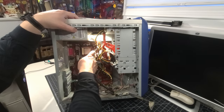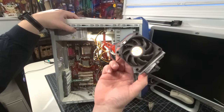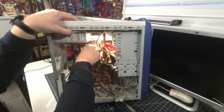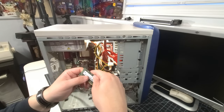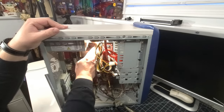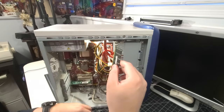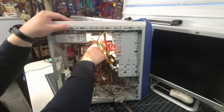There's dust just caked on the board — a direct result of that blanket of dirt inside the heatsink and fan. The memory: three slots on this motherboard, and my guess is DDR. I pull out 256 megabytes of DDR 266 memory. I bet the other stick is the same, giving us 512 megabytes. I'll pop them back in until we're ready to fully remove the board.